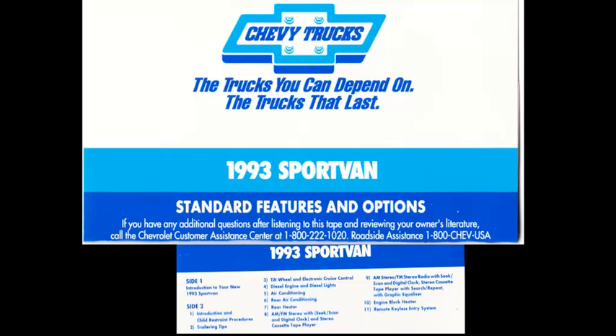If you plan on using your van for transporting cargo, be sure to check section one of the owner's manual for removal of your rear seats. A check assembly or door stop on your rear doors prevents them from opening further than desired. To bypass this check assembly, close the door slightly to remove tension from the holding pin, then lift the pin up and swing the check assembly free. Be sure to secure all items in your vehicle prior to driving. Cargo weight in the rear area should be located as far forward as possible, and don't pile cargo or luggage higher than the seat backs. With the rear seats removed, you can use the seat anchor pins in the floor anchor plates to tie cargo down.